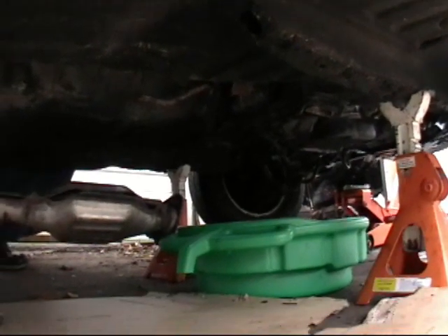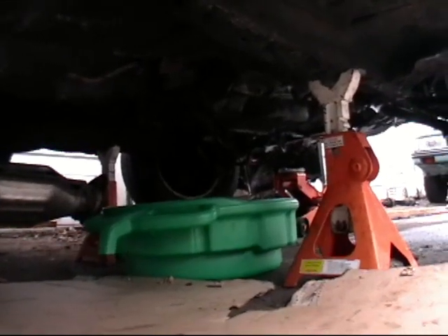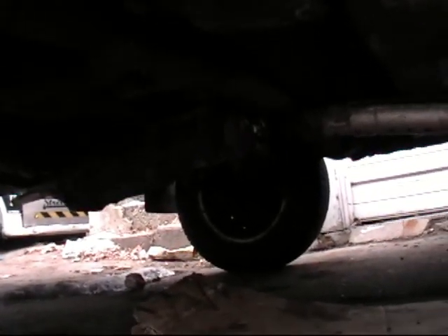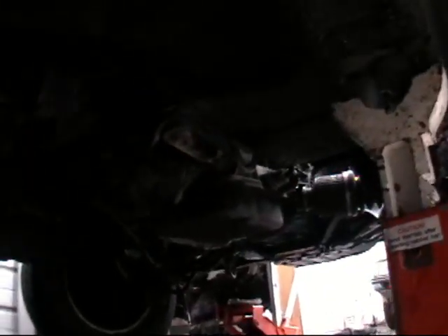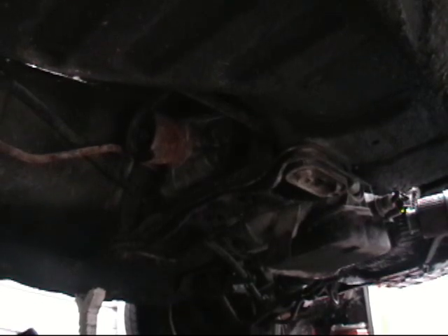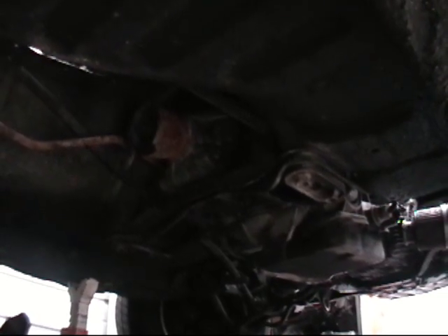We pulled the steering column out to have access to remove this from the car entirely. Underneath the car, we have disconnected the Y-pipe to give us clearance to drop the transmission. We've drained the transmission fluid out, which is good to do because otherwise you're going to have it spilling out of the drive shaft output shaft as you drop it down. The drive shaft has been removed — there are four bolts on the differential end, two bolts at the carrier bearing, and then it just unplugs from the transmission. The axles have been removed with our 3/16 drift punch, with enough wiggle room to slide the axle cups off. Lastly, this crossmember here has two bolts on either side. When we're ready to drop it down, we'll place a jack under the transmission, take those bolts out, lower her down, pitch the transmission back about three inches to clear the engine crossmember, and drag her out from under the car.